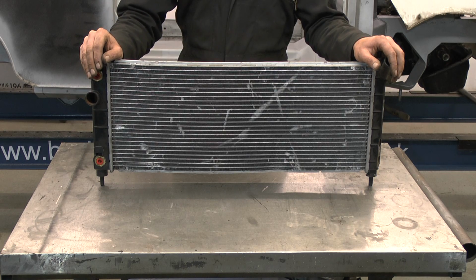The issue with using the Celica radiator is it leaves no room in the front for a decent sized air-to-air intercooler. So we're not going to use one. Instead, we're going to go with a water-to-air charge cooler, which needs another radiator in the front panel. And for that job, I've got this out of a 16-valve Corsa B.